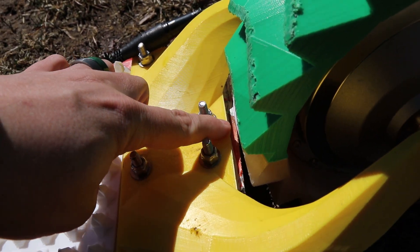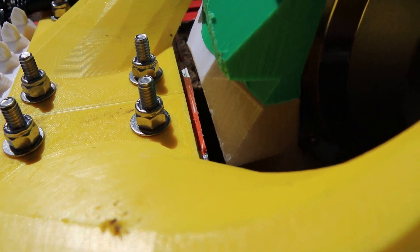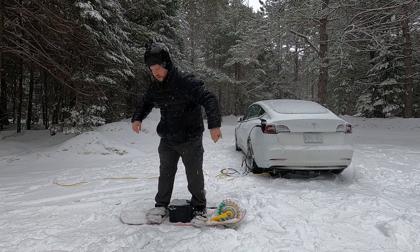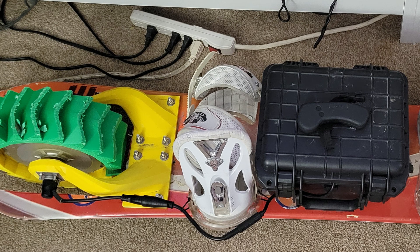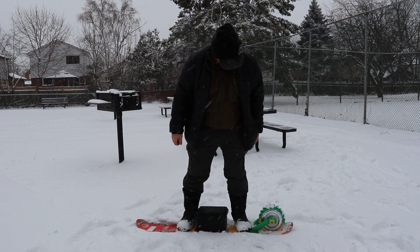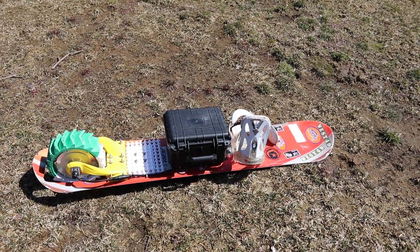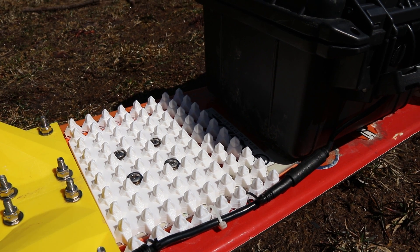Other than just not using it in those snow conditions, I'm trimming up the wheel well to be more flush with the base of the motor mounting arms so I can widen the gap a little bit. As for actually standing on the board, I played around a lot between traditional snowboard bindings and traction pads. Bindings give you really good steering authority and control, but I can't seat the rear binding far enough back to put enough weight on the wheel. Traction pads give free range of motion but make it hard to steer, and eventually the pads get gummed up with snow. So I wound up going with a hybrid setup: one binding up front and a redesigned traction pad with a much more aggressive traction spike in the back.